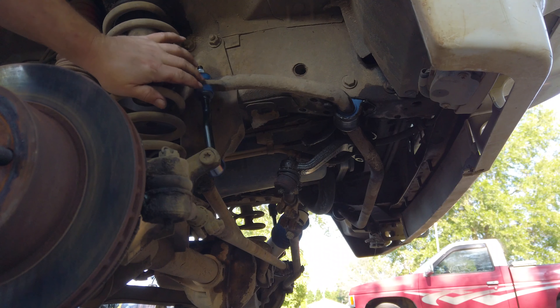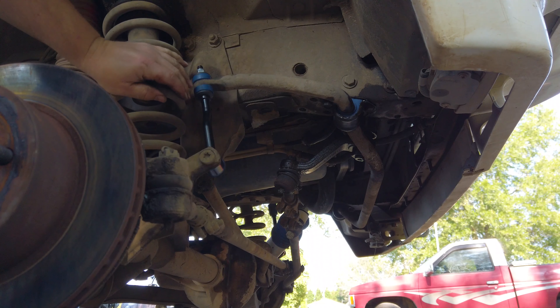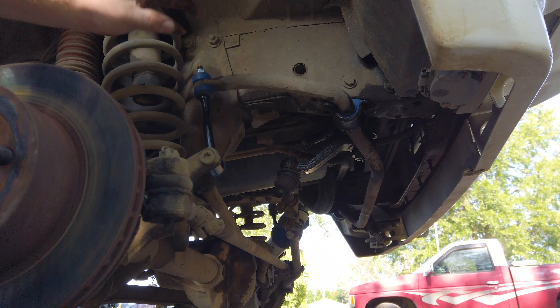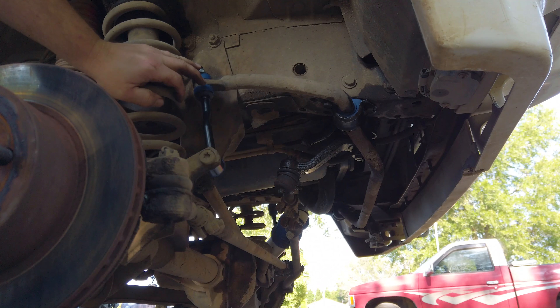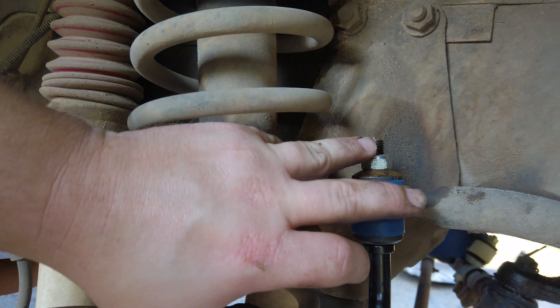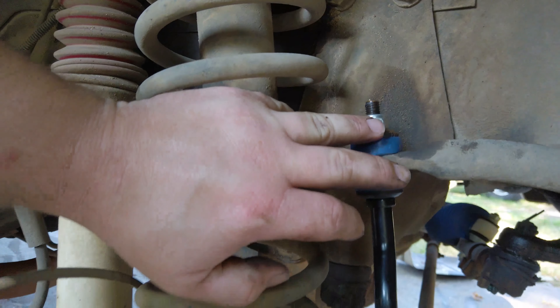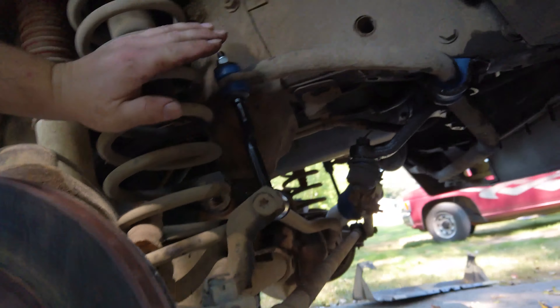All those depressed — you can tell. I'm sure they have a specification but mine didn't even come with instructions. You want to make sure that these bushings depress — and you should be looking at probably almost half an inch, maybe not quite, maybe three-eighths of an inch. But anyways, that's a look at doing a sway bar.